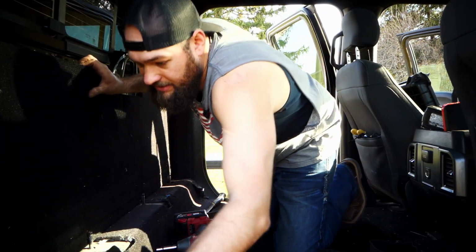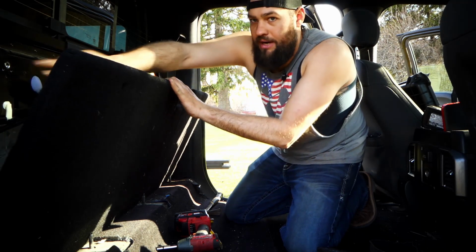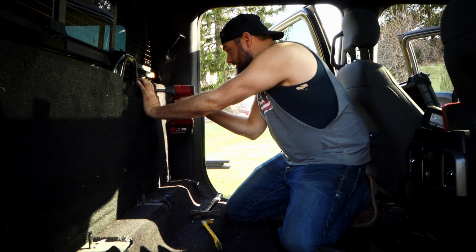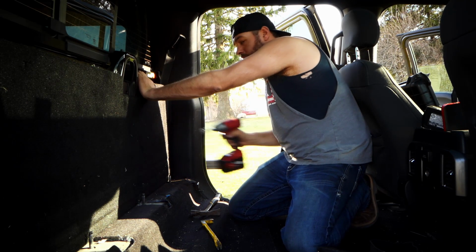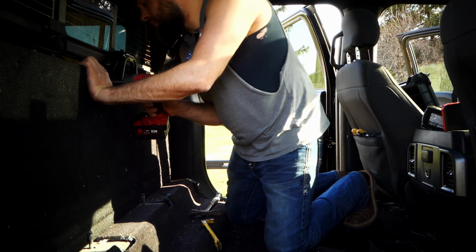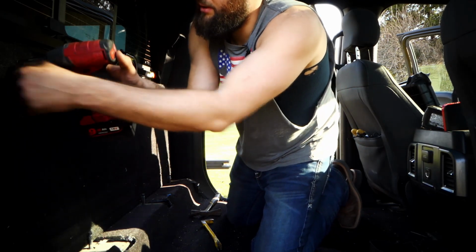I make them kind of tight so they're not rattling around. And then once you have it in place here, you just got to line up your holes. We're going to use the 3 existing mounting holes that are for those little tethers for carrying a car seat. So Lord knows you're going to have 3 car seats back here. You need 3 tethers. So thankfully, just line them up. You're not building a skyscraper here. You don't need to get too robust or hammer on these too much, but it's just a stock 10 millimeter machine bolt here. Obviously, when I laid this out, I marked where those were and drilled accordingly, and it worked out pretty good. So you'd have to do that on your own.